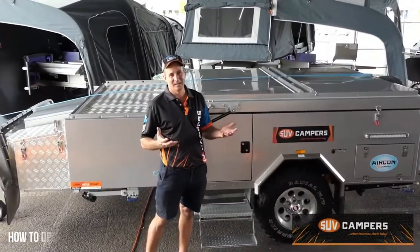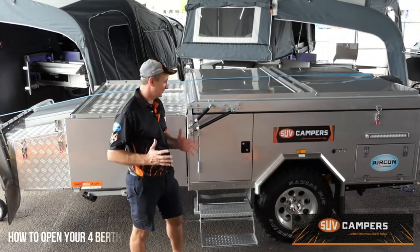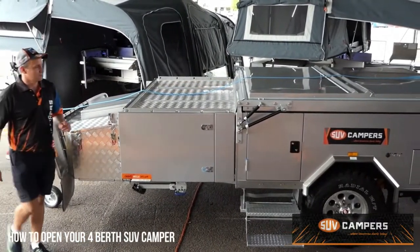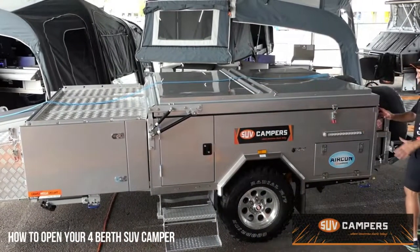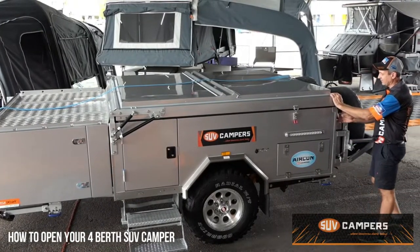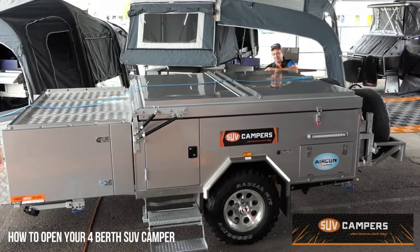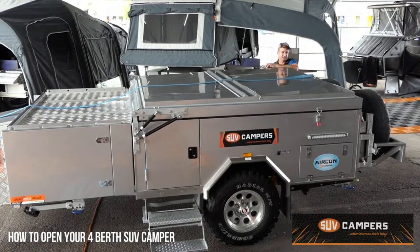Okay, what we're going to do today is quickly and simply open a fold-flat camper trailer. You come to the front, disengage your winch — have that in the neutral position — and then walk around to the back of your camper trailer. You've got four catches: two at the back and one on each side. Release the corner catch on each side first — the safety ones — and then put your elbow on the corner of the camper and release the first camp latch on this side, holding a bit of weight down to take the load off the latch.